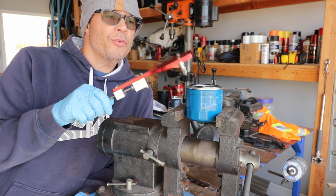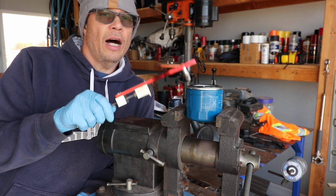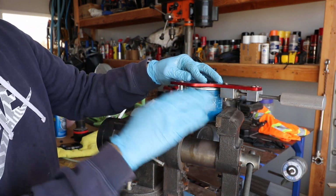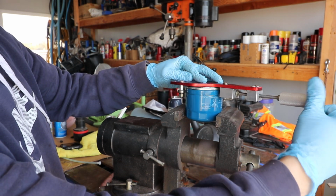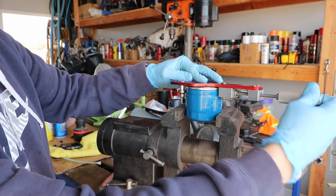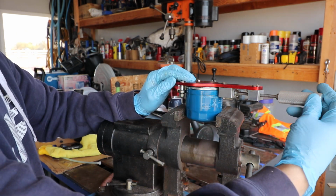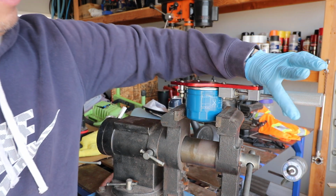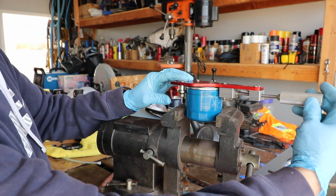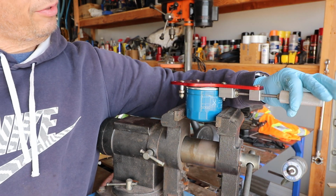We're going to demonstrate how it works on this 2019 oil filter for a Hyundai Tucson. And so the way it works is you put the wrench on, and then you adjust the knob until you touch the filter itself, the metal part of the filter itself, the housing. Okay, now I kind of already started it here. So now that I've already started it, I can go ahead and squeeze in a little more by turning this knob and then just turning the filter a little more. Now I don't feel like I'm digging in much, so we're going to turn it a little more until we get some tension in there, some resistance. And then we're going to turn the wrench again.